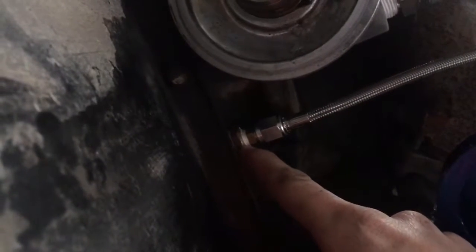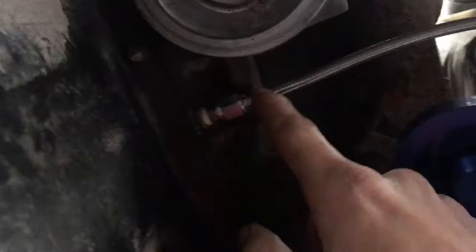I already tested the filter to make sure it fit right. Here's your oil return line — you put that bushing in, then you put the other fitting in, and then this goes to the front port on the adapter. Your rear line, which might be hard to show, is up here — that's the square head — and then it wraps around and comes into the backside. That's pretty much it; looks pretty good. Once I get the filters on I'll start it up and see if I have any leaks.